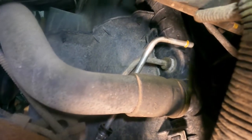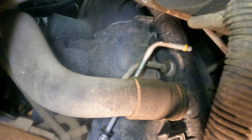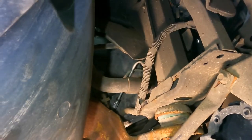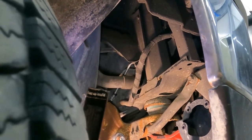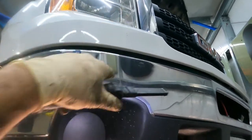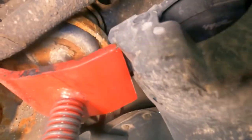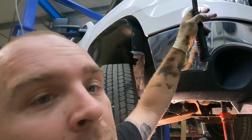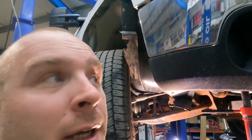Now we have the driver's side line in the grille or bumper hole. Spinning around to the passenger side — you can see that nice new line and the old line underneath. That's the other one that comes from the tranny and drops into the rad, so we need to undo the lower one and put the top one in. It's not easy to get light, hands, tools, and a camera up in there at the same time, so you'll have to take my word for it. The line on the passenger side comes in like this and goes up — I can't even get the camera there. We'll chase it that way. I might try going from the top to give a better visual.